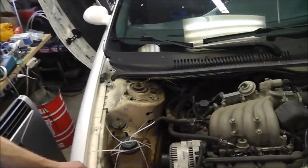The first thing that I had, the cap blew off the radiator or the coolant system right here, and all the coolant came out. Tried to figure out what happened, and got to look in. Looks like the water pump on these engines likes to rust out. I do have really nasty brown water and stuff, so that was probably part of the problem. Replaced the water pump, and I also replaced the thermostat, and neither one of those fixed my problem.